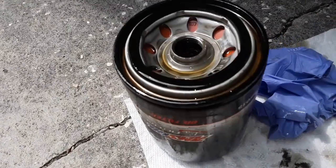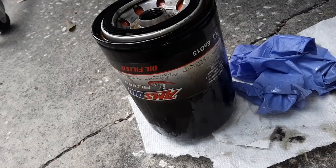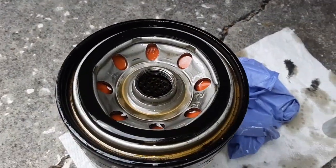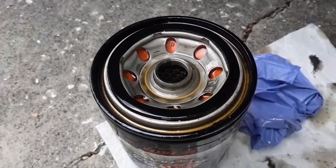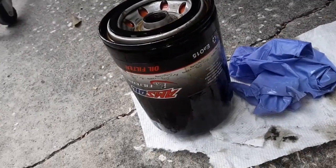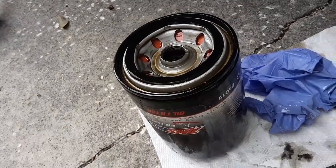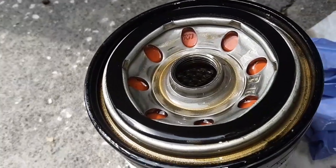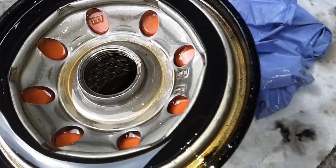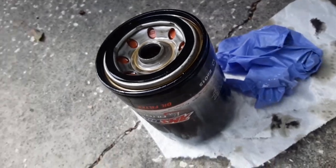So guys, these oil filters are capable of, this one's actually capable of 25,000 miles or 1 year. And if you're using the Signature Series Amsoil, it is too, as long as you're doing all highway driving. Now, most people fall under severe service, and so that's going to be 15,000 or 1 year. And I can assure you, this Mustang is not coming anywhere close to that, but I still want to run the best oil and best filter possible. And you got that silicone anti-drain back valve. You got the synthetic media nanofiber that is 99% efficient at 20 microns.